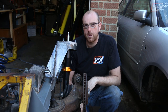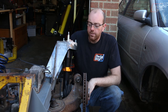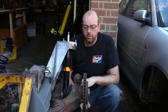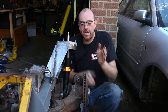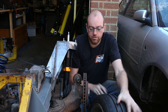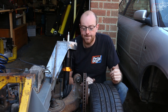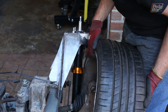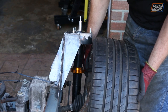Something's been playing on my mind for a few days since we finally located the top of our turrets — they are very low down compared to where we were working before. The top of the turret looks very close to the top of the tire and the inside edge. We've got one of the widest 5x100 fit wheels we have, a 225 off an RTT, and it's not good — the inside edge of the tire rubs and catches pretty hard onto the skirt from the top of the turret.